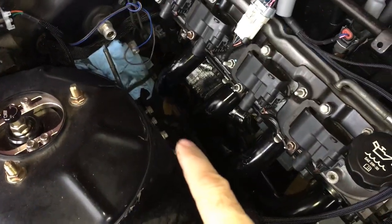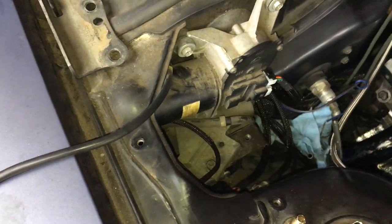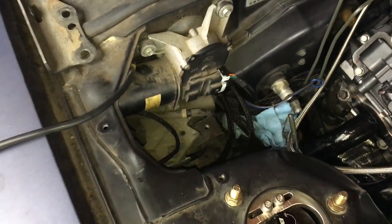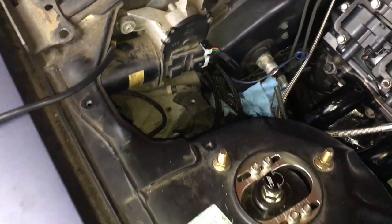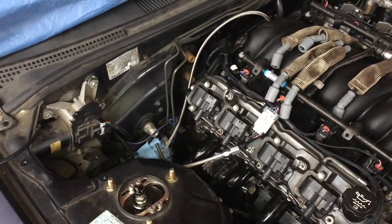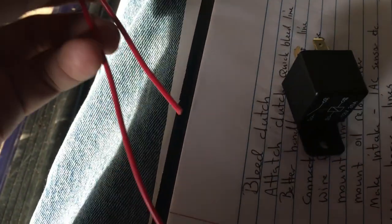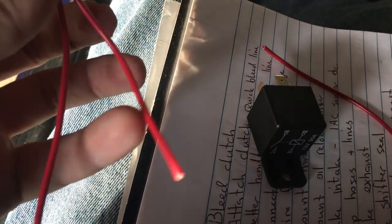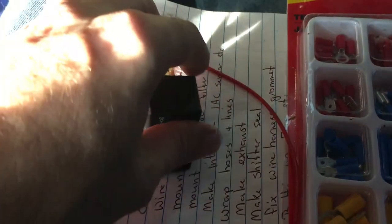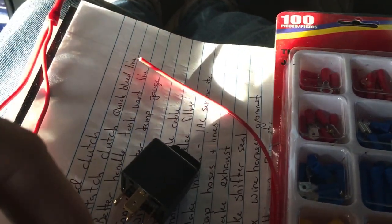It's pretty long so I'm going to look for a place to put it — kind of out of the way. I plan on having the fuel filter here; maybe I could run this down to where this cruise control stuff was that I need to take out. That might be a good location — it could be tucked away, kind of hidden, and then I could run the wire from right here directly in. I've connected two 18-gauge wires — one short, one a bit longer. The short one I'm going to connect to the yellow live wire and it'll act as my new yellow to connect to the stereo. The long one I wanted extra cord for the relay placement.